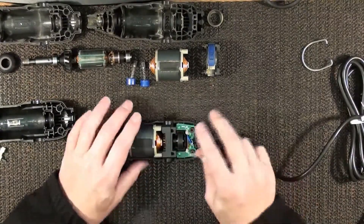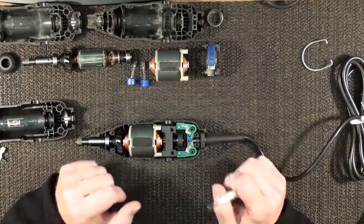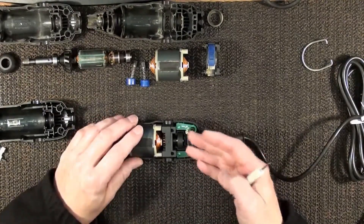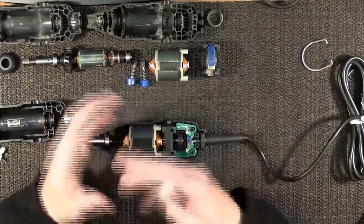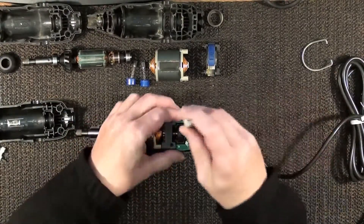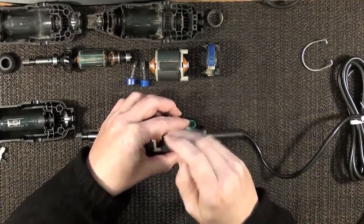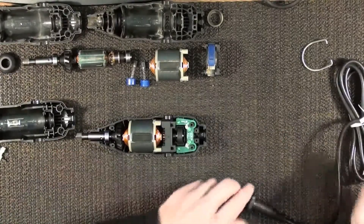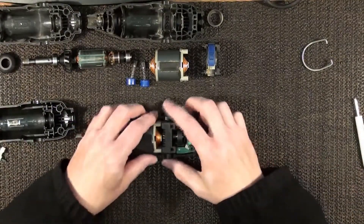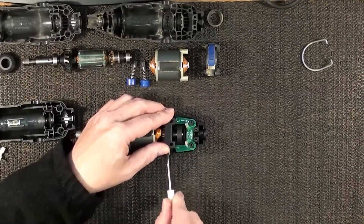So we can't hook this up to the US's 220 system because ours is two phase. This is a single phase, so it's a ground and the 230 is coming over the other line. Alright, let's get this off — we've got to loosen up two screws that are holding the wires. Let's get this cord out of the way. A cord is a cord, right?